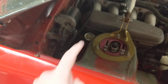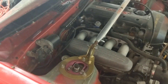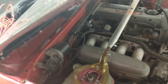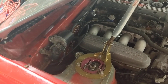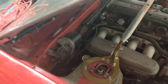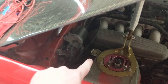I've got my fuel feed here, and then I've got a line that comes off of that and goes over to my adjustable fuel pressure regulator. I have my fuel pressure set to 62 PSI while it's running. I have a Tomei Type S fuel pressure regulator — more than adequate for a Walbro 255. There are a couple of different options when looking at pressure regulators, based more on fuel volume flow. I probably should have a Type L, which is the larger regulator, because I have an overkill fuel pump — an AEM 400 liter per hour pump. It was cheaper than a Bosch 044 inline fuel pump, which I need because I've got a cheap fuel cell. Regardless, the Type S should be just fine. I've got the feed line here and the return line here to the fuel pressure regulator, and then that has a line that goes back to the tank.